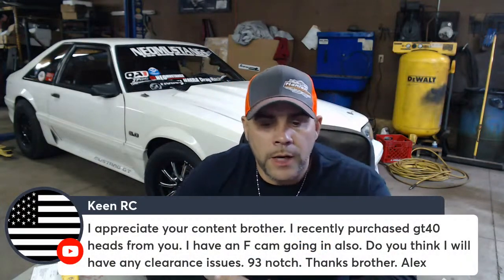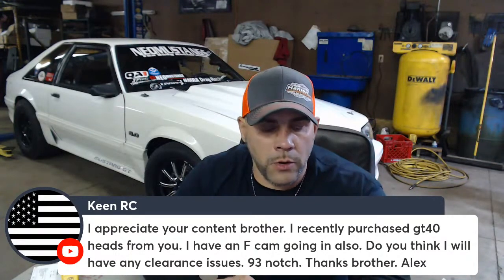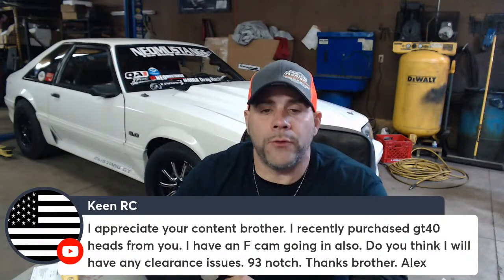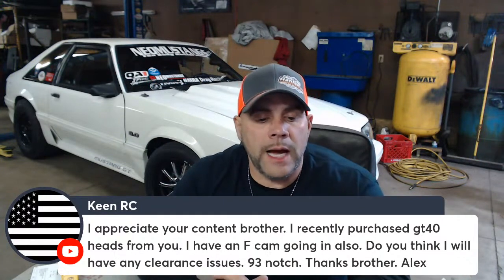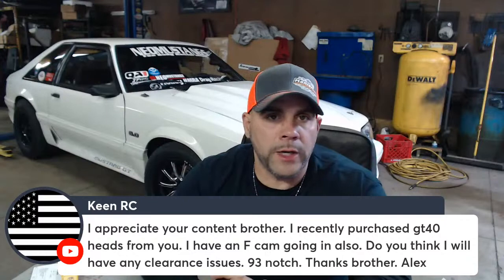But anyways, back to the discussion at hand. I'll keep answering best I can here, guys. I appreciate your content, brother. I recently purchased GT40 heads from you. I have an F-cam going in, as F-cam's great for GT40 stuff. Do you think I will have any clearance issues? Absolutely not. F-cam, GT40 heads, send it, my friend. You're going to have a good time with them.